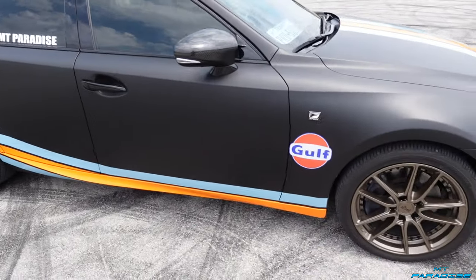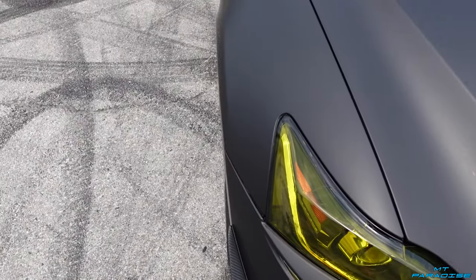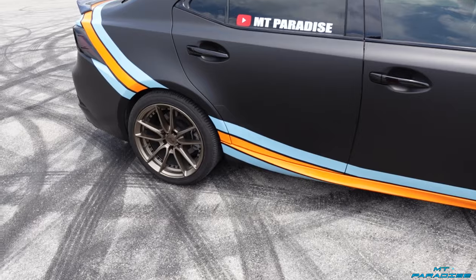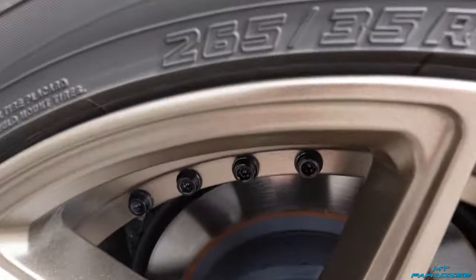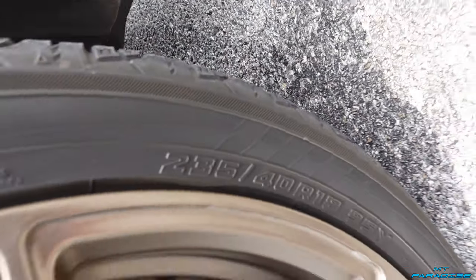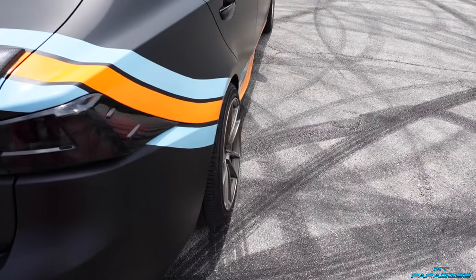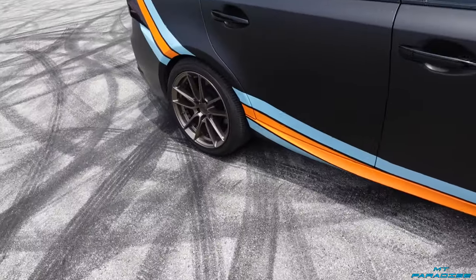While we're walking around the outside of the car, I also have these really nice Niche wheels. A lot of people get spacers to fit them flush, but these actually went with a really perfect offset so they look so balanced. That bronze just looks really good with the design of the wrap — pretty much any wrap looks great with these bronze wheels. I did widen it a little bit — I went with 265s in the rears and 235s on the fronts. With that offset they look absolutely perfect, nice and flush.